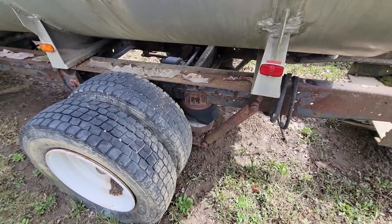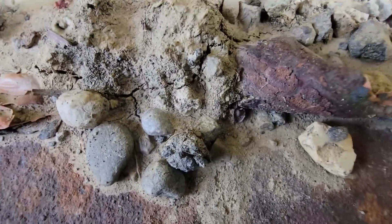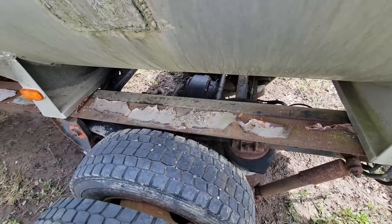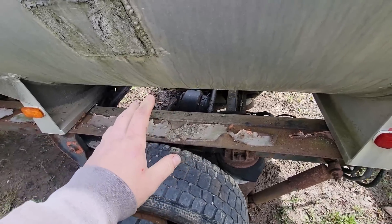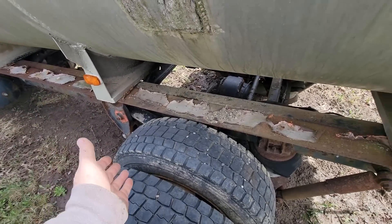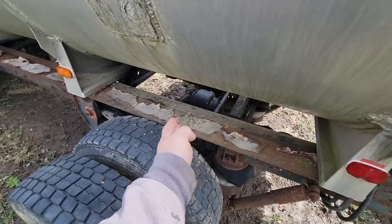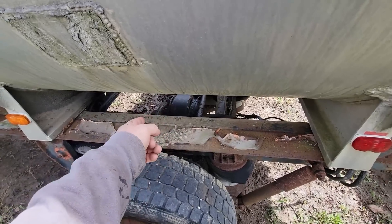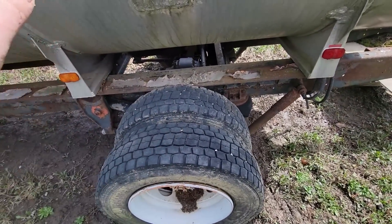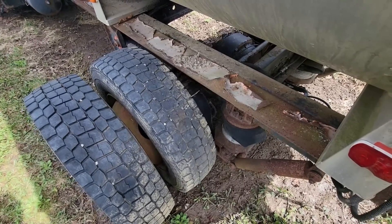I know someone's going to ask why I don't use this axle - it is four and a quarter. The problem is this is a V8 6.9 or 7.3 IDI motor, non-turbo naturally aspirated. It has to turn really high RPMs because it's only about 160 to 170 horsepower. If you're pulling and drop out of those RPMs you lose your power, so it wasn't uncommon for these to have 5.13s and above rear end ratios. This rear end and suspension won't work for us.